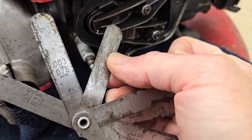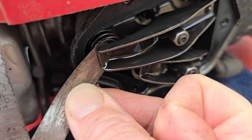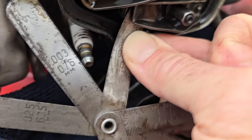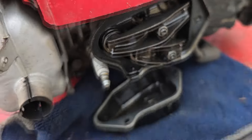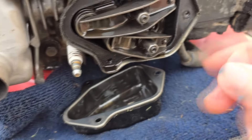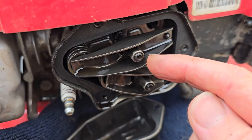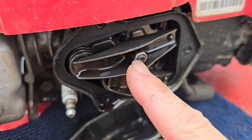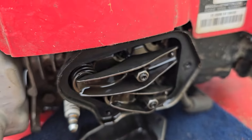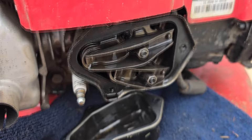Here I've got a 4 thousandths feeler gauge and it's pretty tight. I set it down to about 4 thousandths, which is probably a little snug. I think the intake side I'm about 6 thousandths on. But for this engine, that seems to be where it's happiest. This is a real easy procedure — you just put a closed-end box-end wrench on here, and I think it was a T-15 that goes in here. You're going to loosen this up, tighten your nut down wherever you need it, and then tighten this back. And that's it for the adjustment.